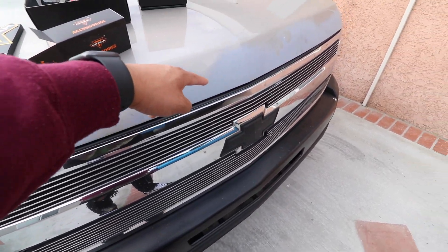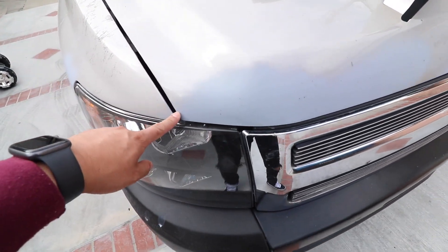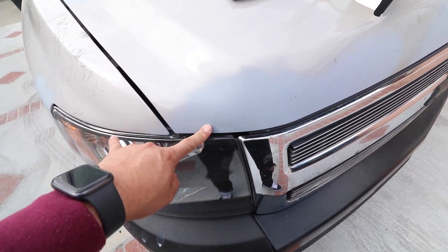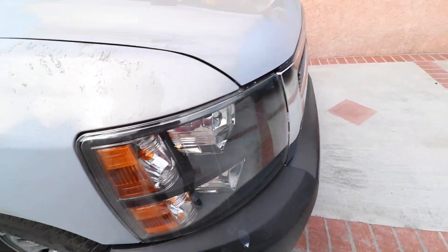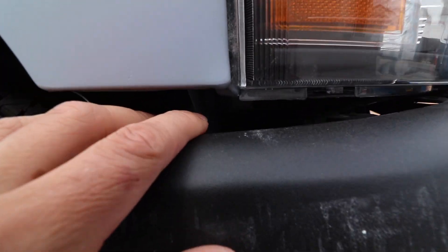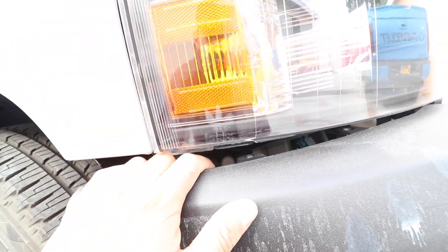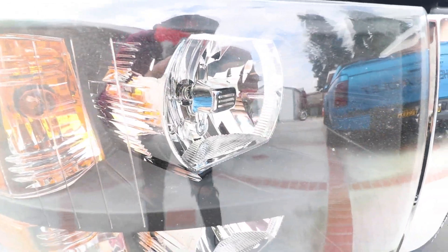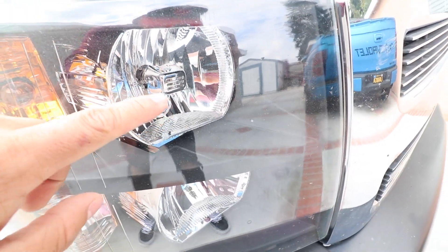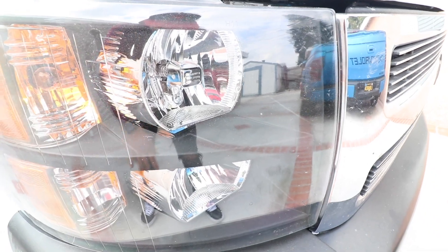There are just a few 10mm bolts on the top here and then clips on the back. The grille gets removed, and then each headlight has — I think it's just three bolts: two here and then one in there, so a total of about three bolts. Then we'll remove it and I'll show you guys how to actually install this. We have halogen right now. If you guys remember my other video, I took the HIDs out and put the halogen ones because it would not pass inspection with the HIDs.